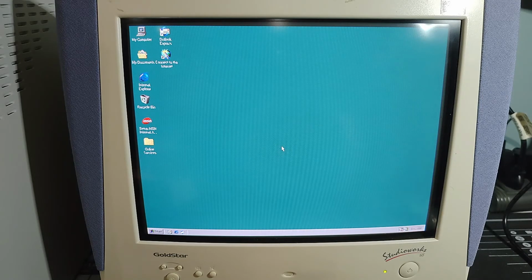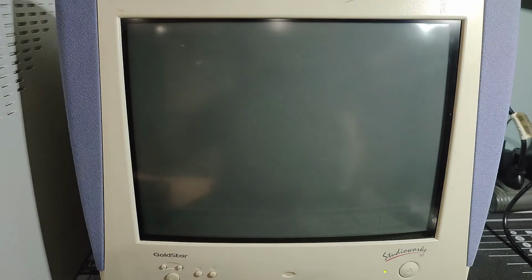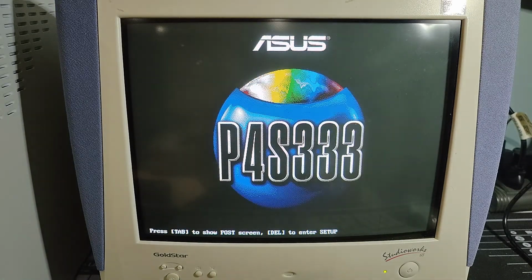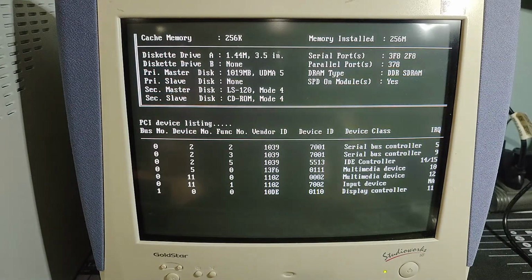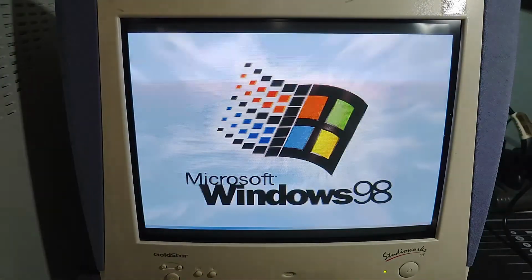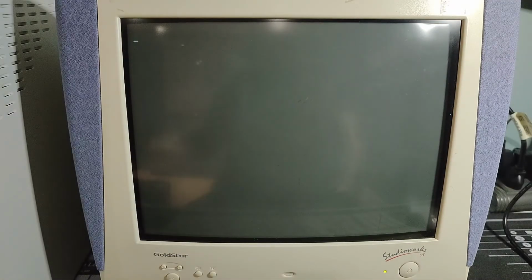because if it's memory that's causing the problem here, where it's got these hang-ups where Windows threw something into memory and now it's having trouble finding it because that extra bit of memory after the 192 is not being read properly. Yeah, we're gonna hit the reset button and hopefully we don't have any issues from applications not installing or uninstalling correctly. And when we get back into Windows here, we're gonna hear that beautiful Windows 98 music. And then we'll go back and check the BIOS. This should be the last time we have to boot with the Windows CD installed.